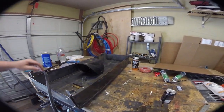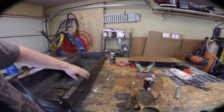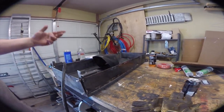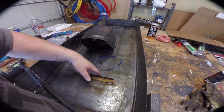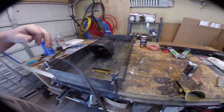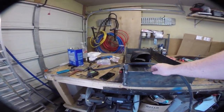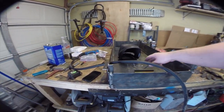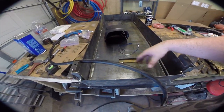The other quick fabrication thing we did was making the rest of the water box — basically just more 14-gauge to protect it from rocks and all kinds of debris. The top part is inside the frame rail so that's protected. I welded on a little piece of angle iron to keep the tank from moving, then we'll put a little foam around it to lock it in place. On this side is where the pump goes — it's serviceable with just four bolts and this whole panel comes off, allowing us to unhook the water or service anything we need. We'll do all the water stuff in a separate video.